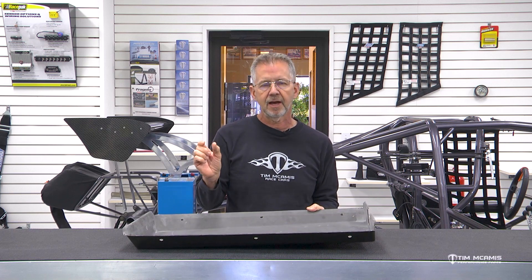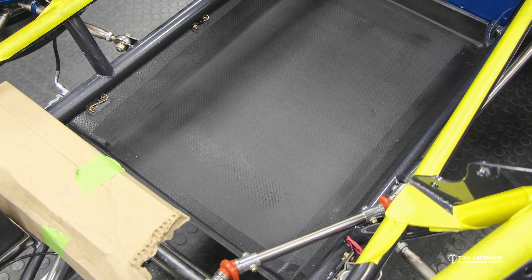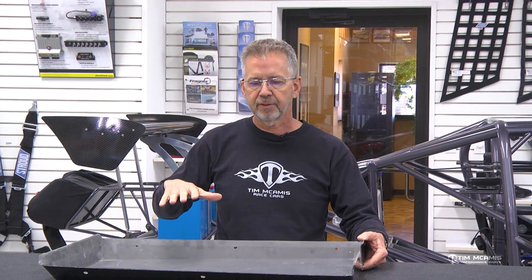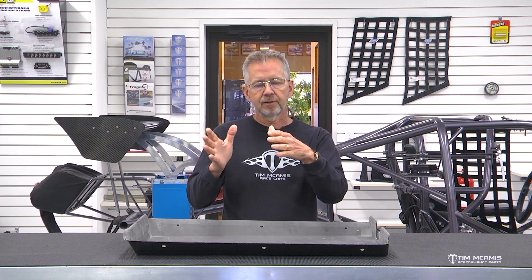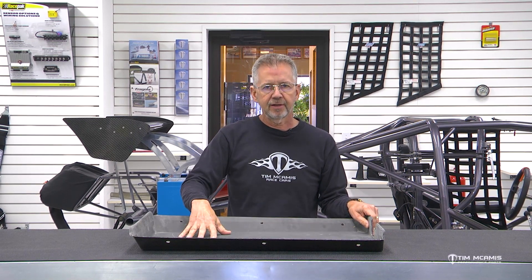You can see there are three holes on each side, and there are going to be tabs welded to the frame rail. This piece fits up tight to the mid plate and all the way up past the front of the oil pan, right around the front damper section of the engine — right at the end of the crankshaft. If you do have an engine failure and need to test that diaper, this is going to help by containing anything that may not be held by the engine diaper, because that lower engine containment system has to fit around things like the starter, the oil pump, and the dry sump pump. There are a lot of different configurations, so sometimes it's really hard to get that little corner pucker out of it so that it will contain the oil if you do have a rod breach the pan. So this is like a secondary containment device.